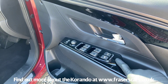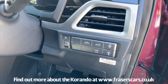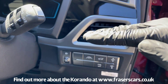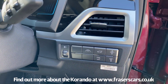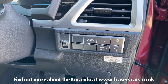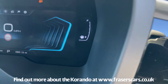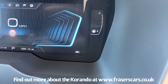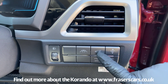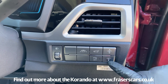Conversely, if you want to lock the car when it's open, push that button. The panel here is your headlamp levelling — zero is the highest angle and the higher the number, the more your low beam dips, useful when towing or fully loaded. This button activates and deactivates your lane departure warning and lane keep assist — a yellow light comes on in the bottom right of the dashboard when active. On Ultimate automatics, that's the inside button to open the power tailgate. The next button turns off your front and rear parking sensors, and there's an illumination adjustment for all the displays.